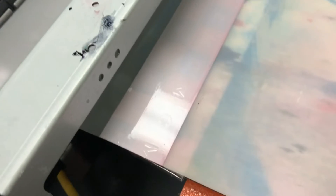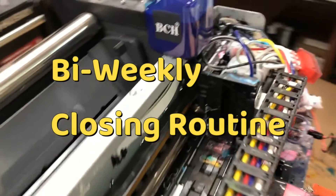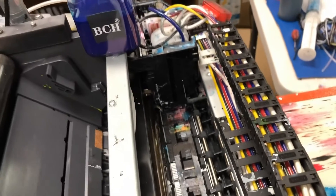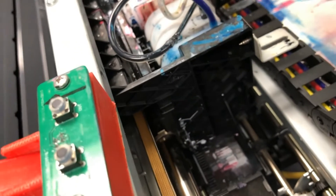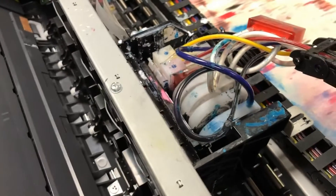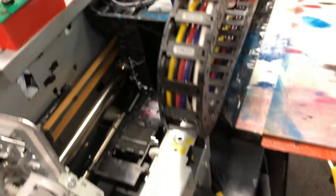Look at how even that wide is. Twice a week, we're going to add some extra steps to the closing routine. Again, restart the printer. Once the carriage moves to the left — if you're facing the front of the printer — shut the main power off so the carriage freezes right there. Now turn the main power back on and turn the printer's power on. When you turn the printer's power on, you can see the carriage is going to freeze up.